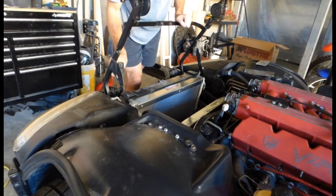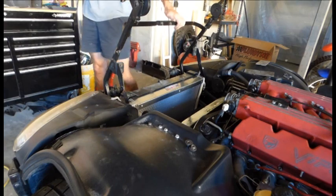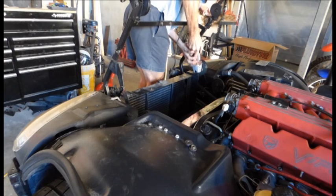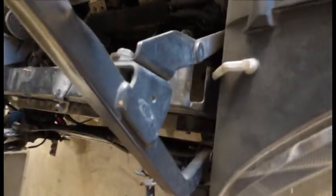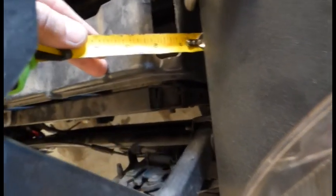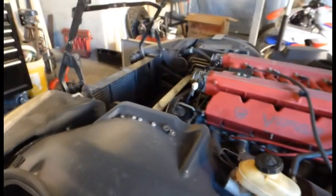I think I'm going to have to get the cutoff wheel and actually cut the shroud a little bit to gain clearance. I didn't want to do that. Let's measure the size of the gap now — right around one inch wide. So, using the Fluiddyne radiator, be prepared — just saying.